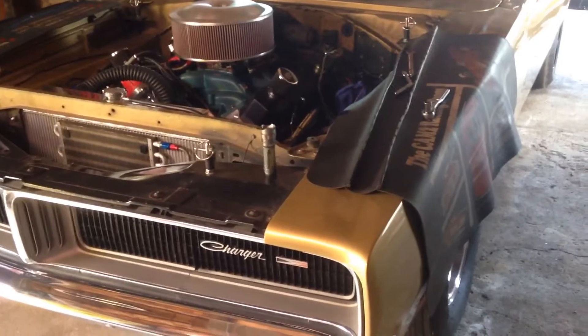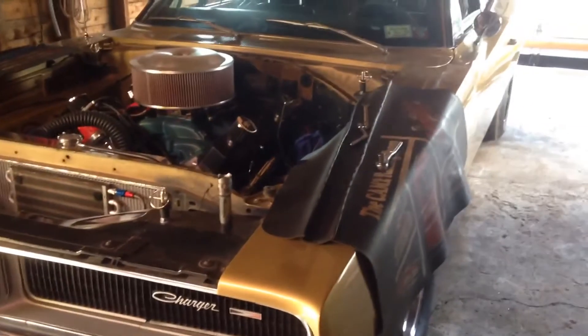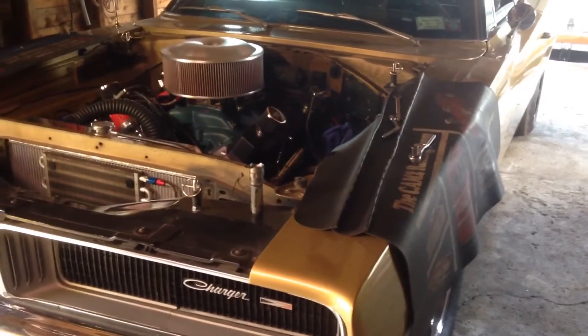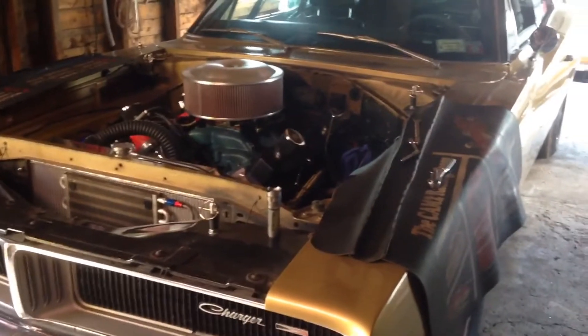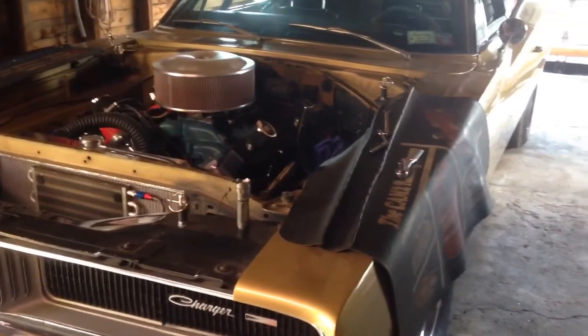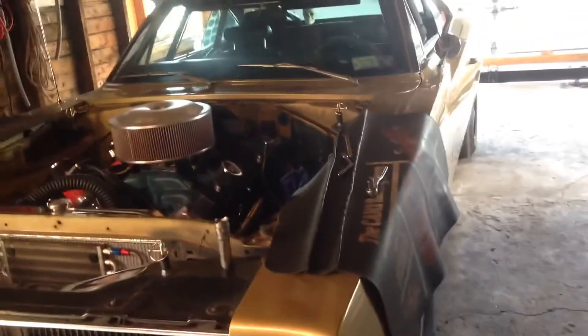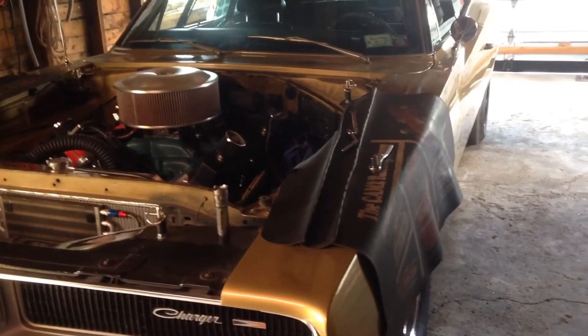At 100, 112, 118 miles an hour the drums do not work good on the drag strip. The original 14-inch wheel drum setup — whatever size those drums are, they're pretty small. You only got like two good hits at the drag strip, so we decided to go with the discs and they work better.